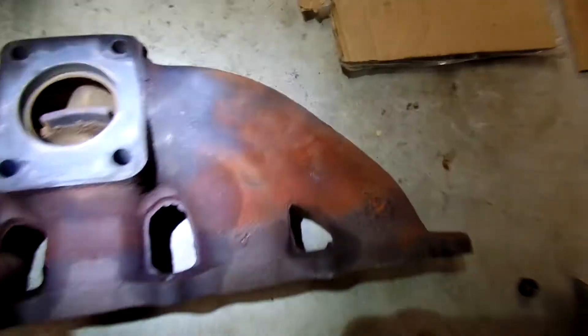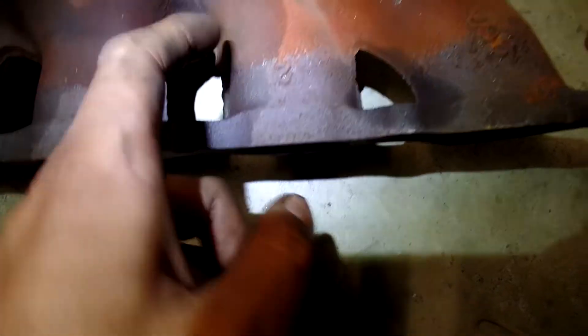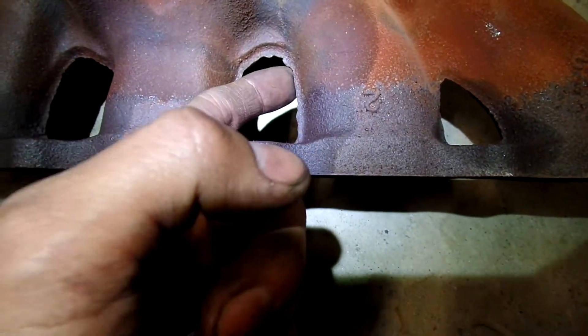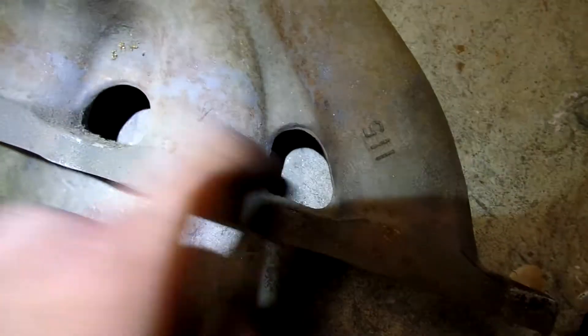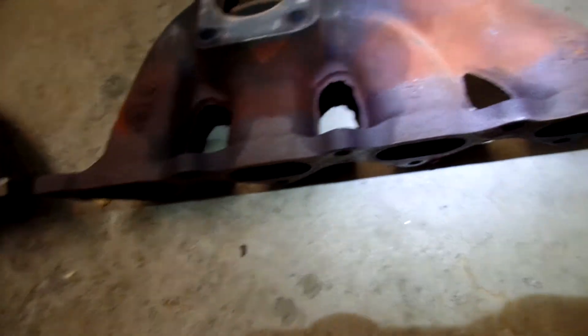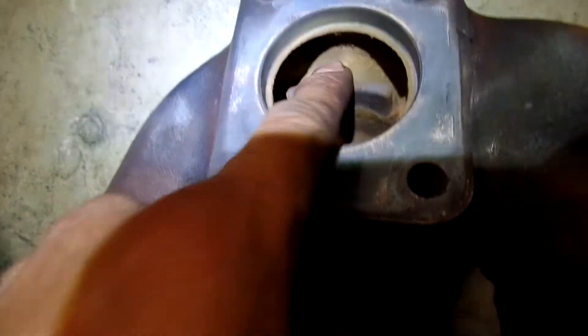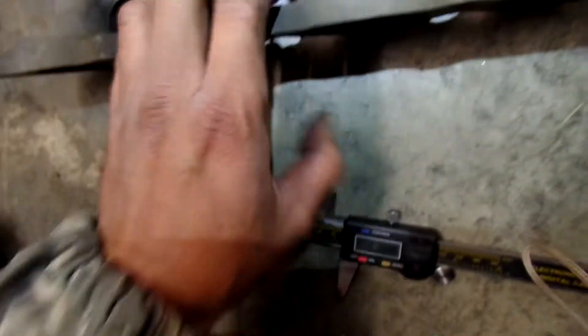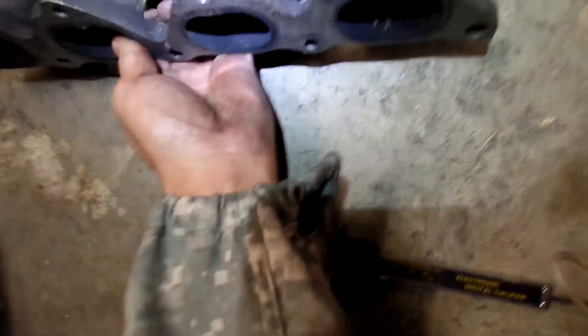But I can tell you this: the casting on this 1G manifold is horrible. Look — it's much smoother casting on the 2nd gen manifold. These have different part numbers on them. It looks like the collector portion is a lot thicker on the 1G than the 2G. So the 1G looks a little beefier. Look at the top sides.